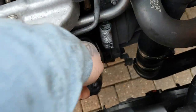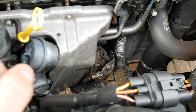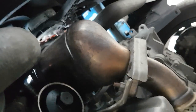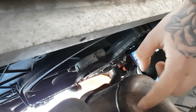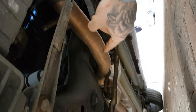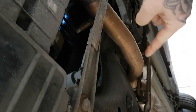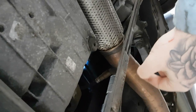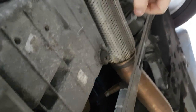Put the O2 sensor to one side. You can disconnect it from the bottom, but personally I don't unclip it from the loom so the wires aren't twisting and causing damage. Now under the car — my camera keeps zooming in, so apologies — but here is your pre-cat that connects to your secondary cat just here and runs all the way down. You can see the new exhaust where it connects. You'll need this cat in place for your MOT. You can get sports cats, but I haven't done that yet.